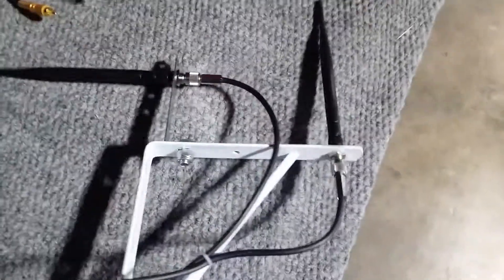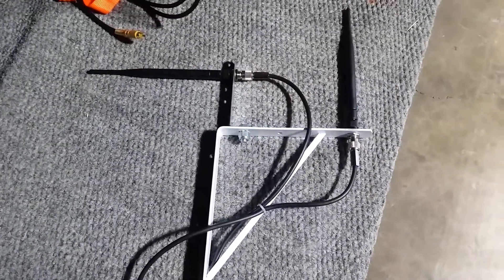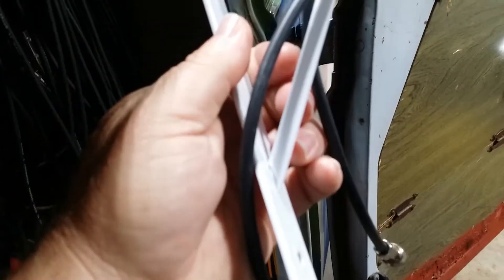So here is what I've come up with. I bought two half-wave antennas and two 18-inch pieces of coax. I went down to the big box at Home Depot and just got a regular reinforced shelf bracket. I'm going to bolt this to the top of the van on the other side, with this mounting hole here at nearly the roof line, and I'll have two good screws going into the camper top on the van. I'll have six inches or so above the van to where this top bracket is, and I've mounted an additional bracket there for a horizontal antenna and a vertical antenna.